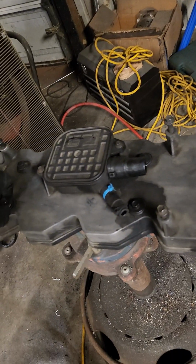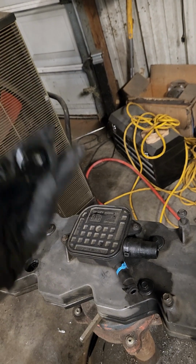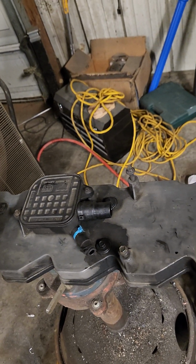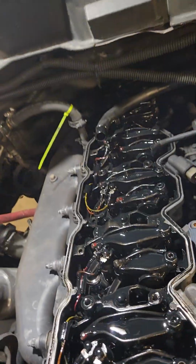And these bolts right here, they have these grommets on there to seal them off. That's a new bolt, actually, I think. They have grommets to seal that hole off, because these trucks are very common for making crankcase pressure naturally even. So that's not an uncommon thing. Now we got to pull this injector rack out.